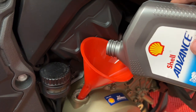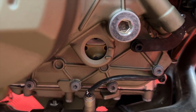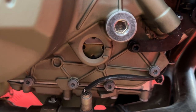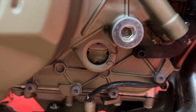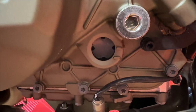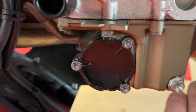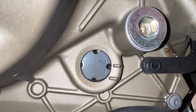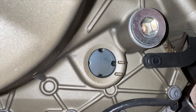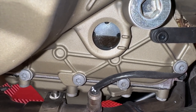Nothing like beautiful, fresh, clean oil going into your engine. Right now I have about 3.35 quarts in there and the line is up above. I have one full quart left, but that doesn't mean the level is good — I have to run the bike, recheck it, and then top it off. It'll be a little bit of a balancing act. Now that we ran it for a couple minutes and let it sit, 3.35 quarts is not enough. I added another half a quart. Let's run it one more time, let it sit, and double check — that should be about perfect.